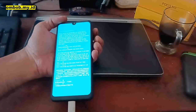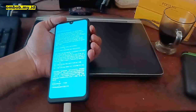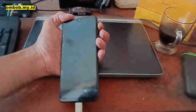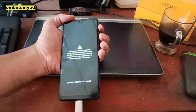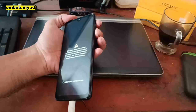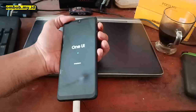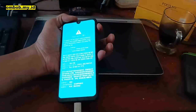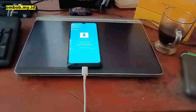After confirming, the phone will automatically reboot and format your internal storage. Wait until it goes to the stock recovery and starts formatting. After it finishes, enter Download Mode again by pressing Volume Up and Volume Down at the same time, then press Volume Up once. Now you're good to go.